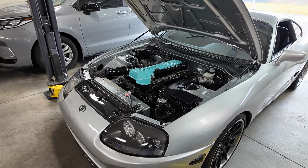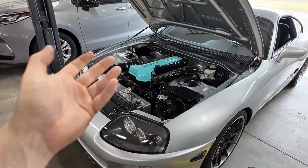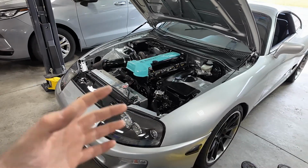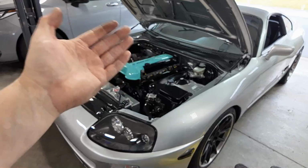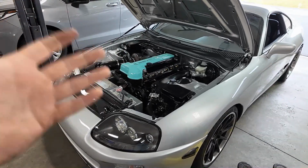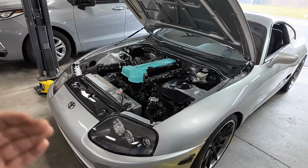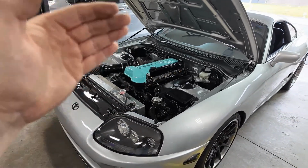So if I go into reverse or go into drive, I add more physical idle control, so it actually gives more idle offset base and fuel and everything, and it'll be perfect. I'll get it great, drive it all day. Then like this, I haven't driven in a couple weeks, pulled the trans, which does nothing, put it back in, fluid's all good, nothing's changed there, and now it's not idling properly, it's idling low. I rev it up and it doesn't catch itself.